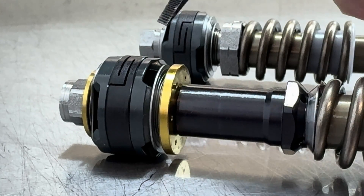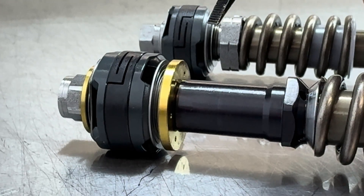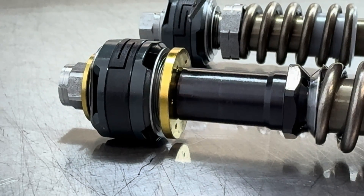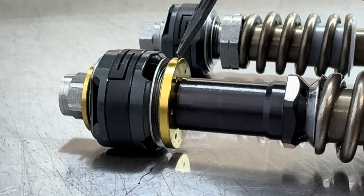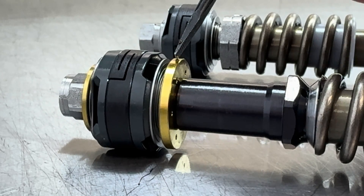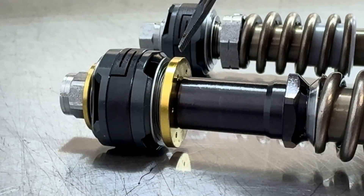The system is also a lot more compact — we no longer have the large cone spring, the cone, or the cone adapter needed. There's something to be said about simplicity in the setup and a little less weight and inertia moving up and down in the system. Ride JBI likes the leaf spring system a lot. It's something that Yamaha has proven to work really well in their KYB forks, using it on production bikes since 2018 and in all of their KYB kit forks also.